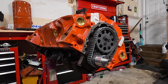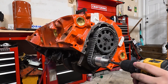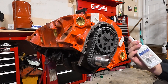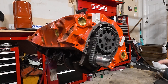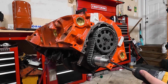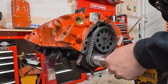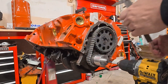Now comes the scary part. This is the drill bit that came with the kit — it goes in just like that and helps keep it centered, though there is still a little wiggle room, so try to keep it nice and steady. I'm going to lube it up with a little light machine oil from the hardware store — put a little on the drill bit and jam some in the hole. We're only going to go about an inch deep, so let's mark it with tape on the drill. That's plenty of thread — we don't need a ton. When the drill hits that tape, we've gone plenty deep.